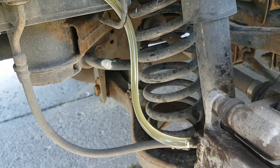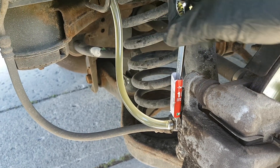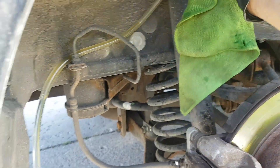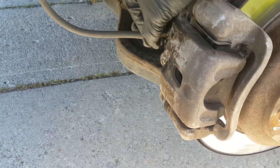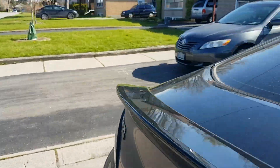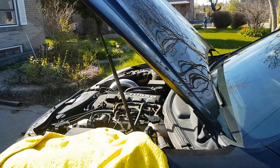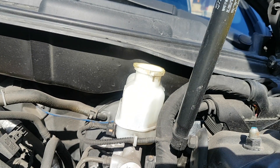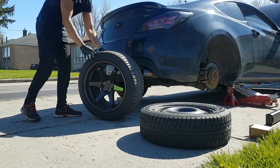If we clearly examine this tube, there are no air bubbles — therefore the system is free of any air. Now we can go ahead and tighten this bolt back on and remove the tube. Hold up the tube and let it drain down into your bottle. Once you get that done, just cap it off. Since we drained some brake fluid into the bottle, we've got to put in some new brake fluid into the reservoir — fill it up to the max line, then cap it off.